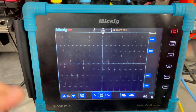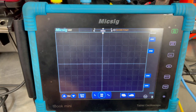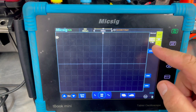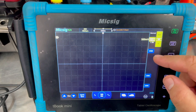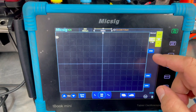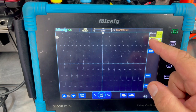Looking at the home screen of our MicSig, we have channel one, channel two, three, and four over here on the right-hand side. Right now I do have the scope on stop — I'll go ahead and press play. Channel one is going to be connected directly to our battery. Notice here we see channel one at 200 millivolts, then we see a millivolt scale and a volt scale. If I want to go up on voltage, I'll hit the volt scale — now it's 500. It's not 500 for the entire screen; it's per division. We have 10 divisions, so that's times 10 — 5 volts. One volt gives us 10 volts, two volts gives us 20. We are doing a relative compression, so 20 volts would be sufficient.